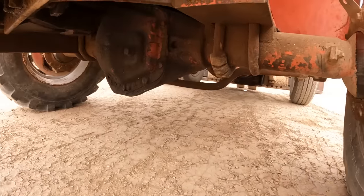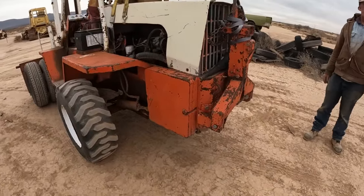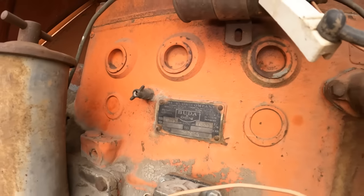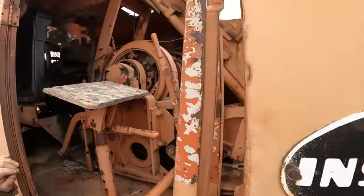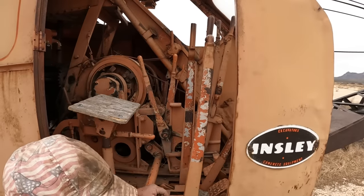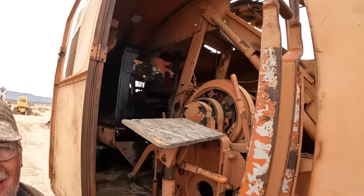Just got a regular closed knuckle axle. That's a nice little tow - is that for flat towing it? It leaks on the back. It's like a centrifugal pump on this one - ain't no hydraulics on it whatsoever. This handle here is three functions: it makes you go forward and back, rotate the circle, and you pull this dog out up against that gear and that raises your boom.